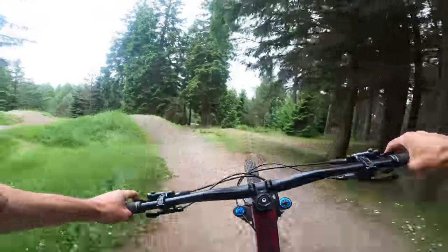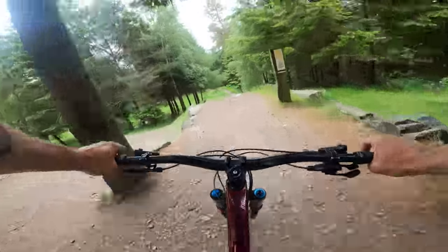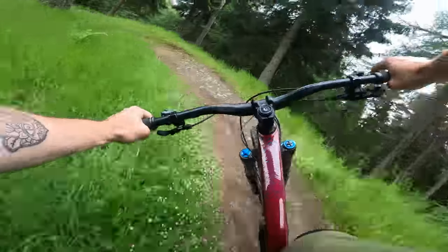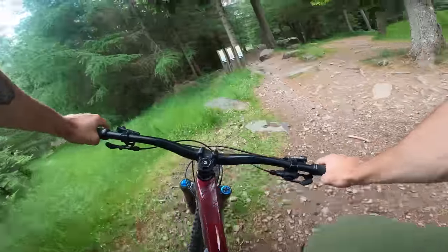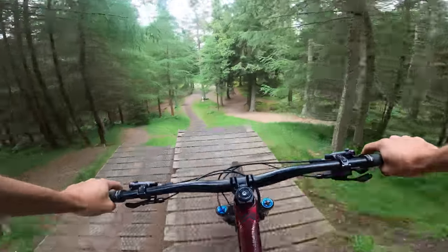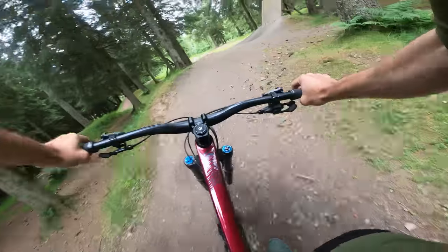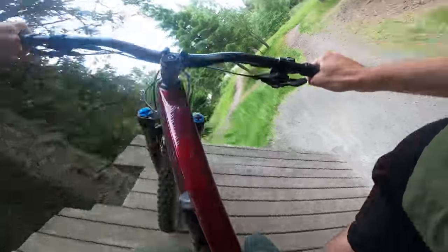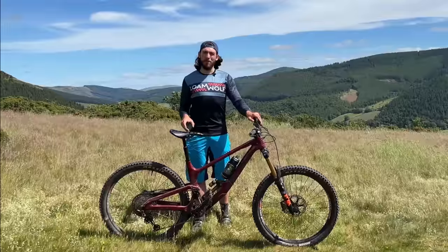With the Claymore, Deviate has covered all of the main desirable features that you'd expect to see on a modern enduro bike. There's a big carbon bolt-on downtube protector to keep the frame safe. There's a threaded bottom bracket, which should eliminate the chances of creaking in use. Boost rear end, tapered head tube, and Deviate opted to go for a 34.9mm seat tube, which gives the dropper post a little bit more room for its internals.